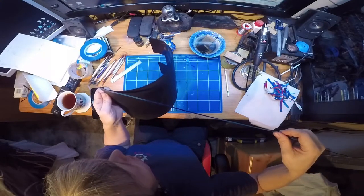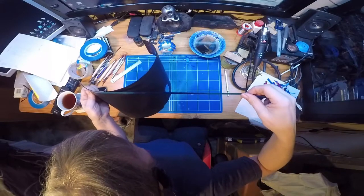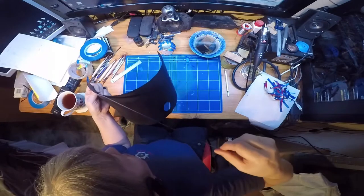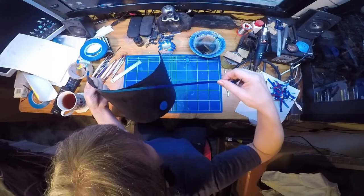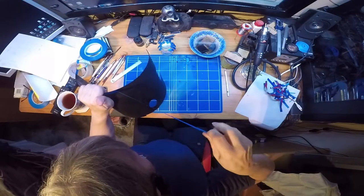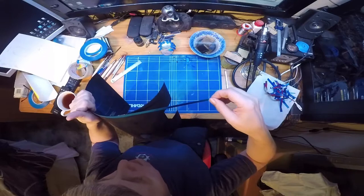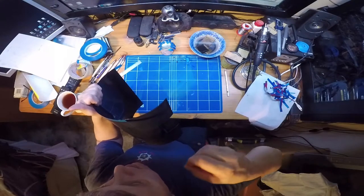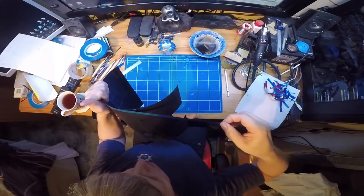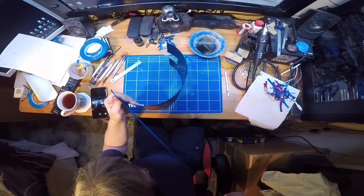Basically, you try and get a long line and slowly but surely you add distance on the tape as you go across. Tape is flexible, so if you pull it too much, you will distort it. And you get used to being able to pull a reasonable length. So that's a wee bit shallow. So, as I say, out again.